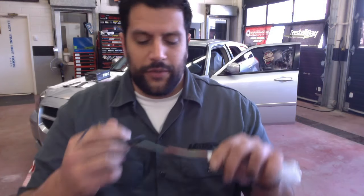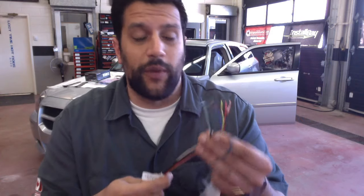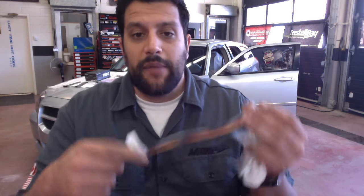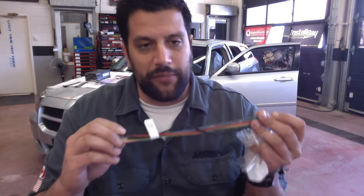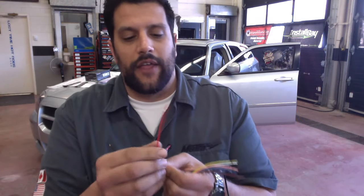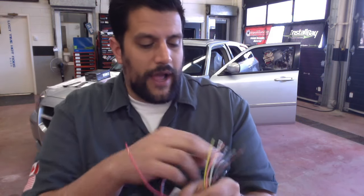Here's a quick tip. When doing connections on this harness, make sure you're doing solid connections — Western Union connections, soldering and heat shrinking, depending on your install bay. No butt connectors, no T-taps. When hooking up the ground, make sure it's a reference ground. This red wire is for your switch power, which turns on and off with your radio. The 3.5mm jack communicates steering wheel control data to our interface from your steering wheel.